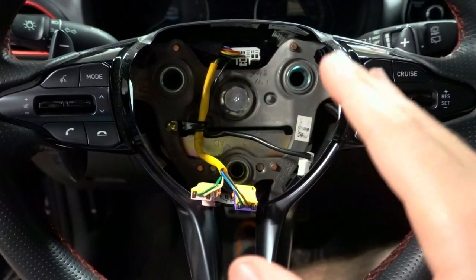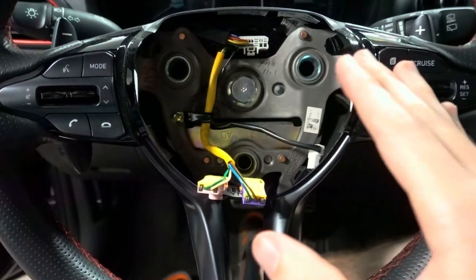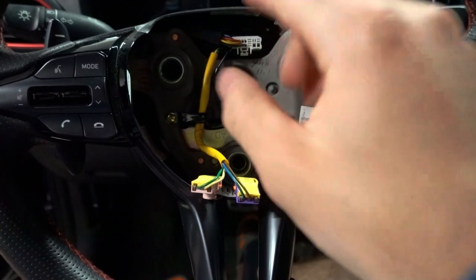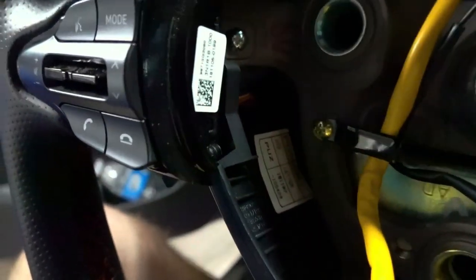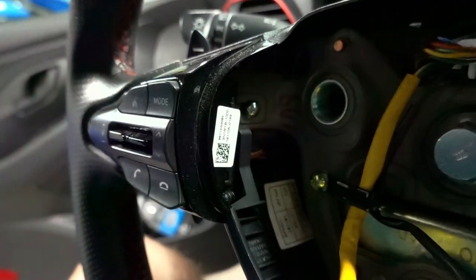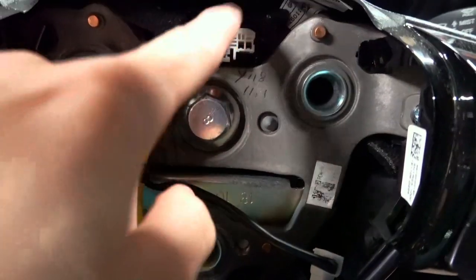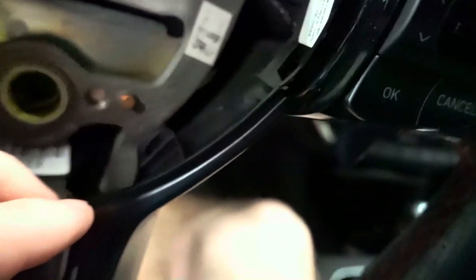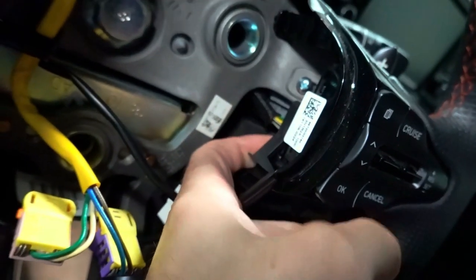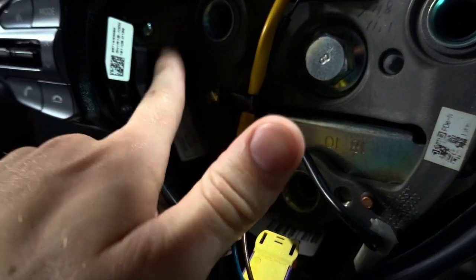I want to give you guys an in-depth look since this isn't something I saw online. It's honestly not as bad as I thought going into this. Here we are inside the steering wheel. Obviously this is the main steering wheel nut you'll need to remove if we need to take the steering wheel off. There are a couple of promising signs — I believe these are the screws we need to remove for the entire paddle shifter assembly: one here and one right over here. We can also access the connection through the clock spring from inside. Here is the trim piece we're going to be replacing, and the screw is right here on the back side of the control panel. Let's start with the paddle shifters since that's something we can do pretty easily.